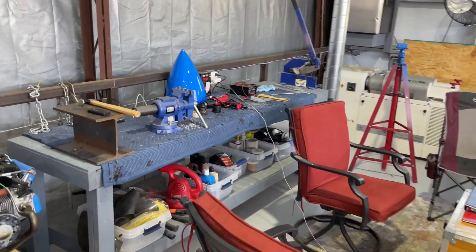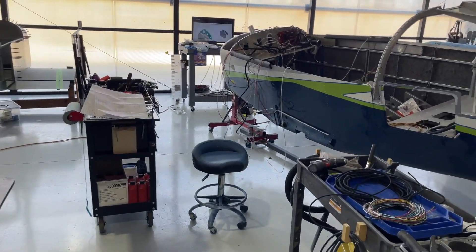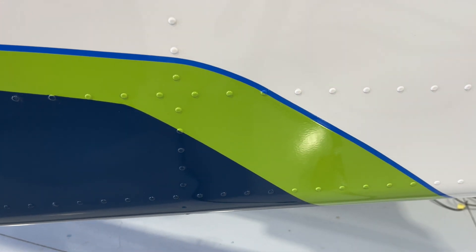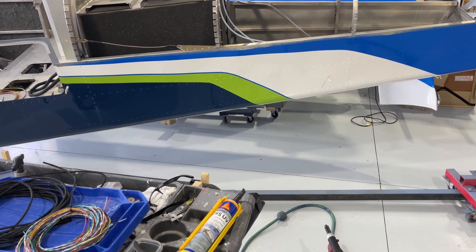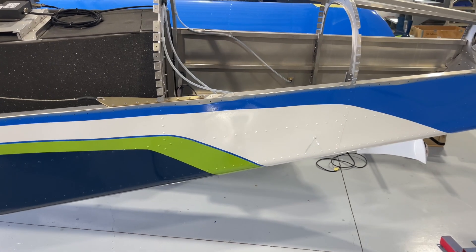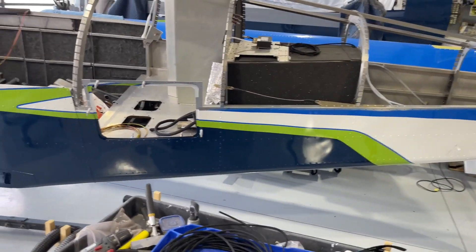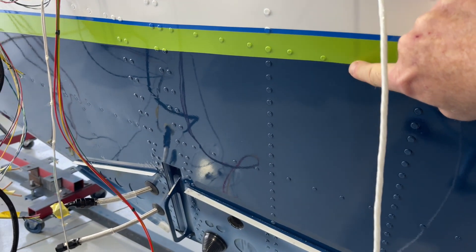There are lots of places where, for example, if there's a rivet — see right here — you've got to split that rivet in half and I'm using aluminum foil tape for that. You can't just put masking tape over it; you've got to make sure that line is clear with no bleed-through on each side of each rivet. Every time you encounter a rivet it's maybe 10 minutes to get it masked — guys doing this professionally probably don't take 10 minutes to mask a rivet. Look at all these rivets here — every one has to be masked off perfectly.